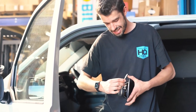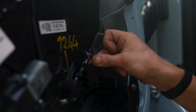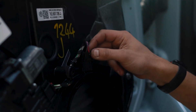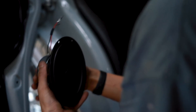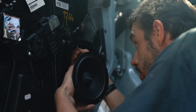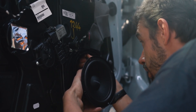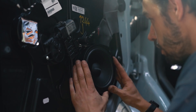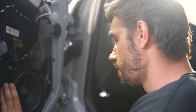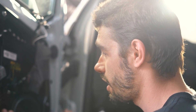Next step is to mount the speaker and also put the pins in on the plug, which is a little bit awkward. You have to look at which way the plug goes, see which is your positive and your negative. The red and blue is your positive, the brown on the blue is your negative. Then work out which pins it is and locate the speaker pins inside the holes — so we go in at the end on this one. There'll be a little click when it's located.